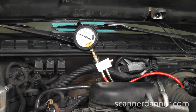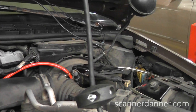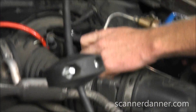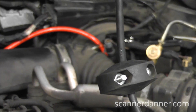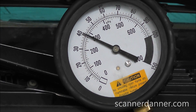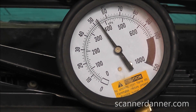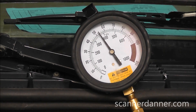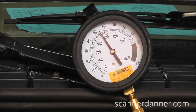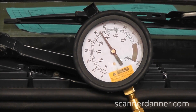Let's put some propane in the intake and see if we can catch that. We have the intake air temp sensor removed and we're putting the propane into that port — behind the mass air flow sensor, where the intake air temp sensor goes. Focus on the fuel pressure gauge. Okay, go ahead — propane and crank it. Okay, shut the propane off. You see the reason the vehicle is continuing to run is we have over 50 pounds of pressure now, and that's what's going to keep this thing running. Now if we do some snap throttle tests, they're not going to pass. We got a bog and popping through the intake — those are all symptoms of not enough fuel. We got a weak pump. That's what the problem is on this vehicle.